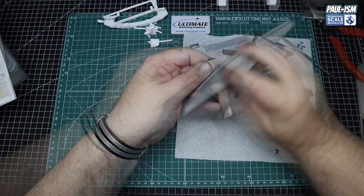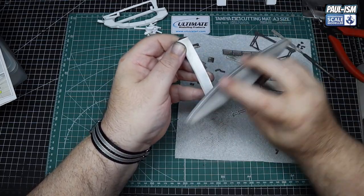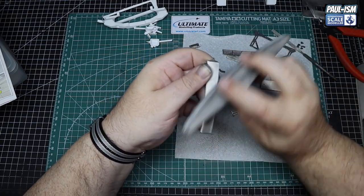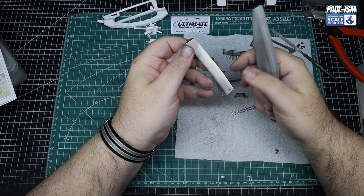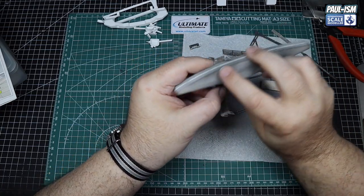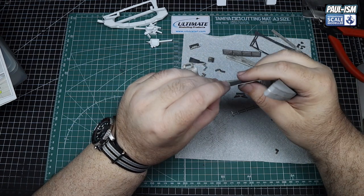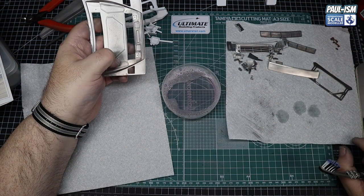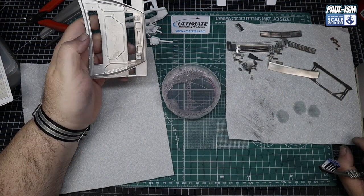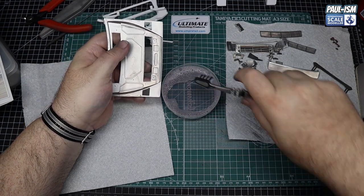These will have to be acid etch primed as well, separate from the body. So if any parts are attached to the body to be sprayed as well, they're going to get grey acid etch prime first, then glued into place, then prime white with the rest of the car, and then painted white. I am going to paint all the white metal in acid etch just to make sure we get the best possible finish. You saw the rear spoiler there as well, which was quite heavily misshapen. So that was also straightened up as well.